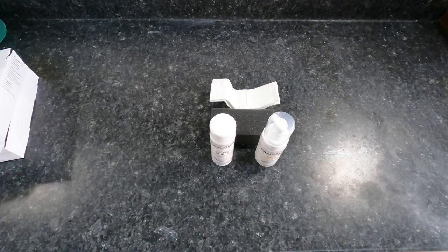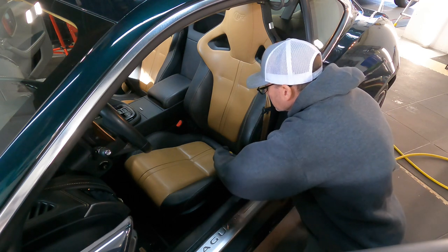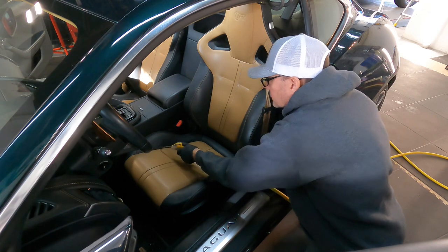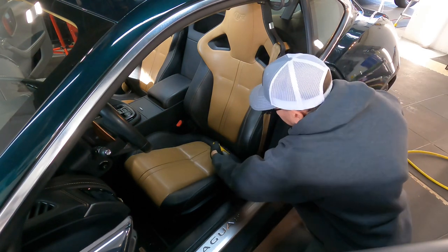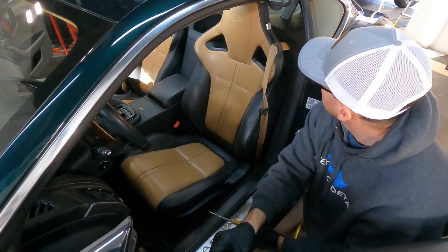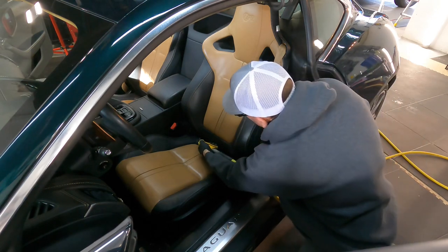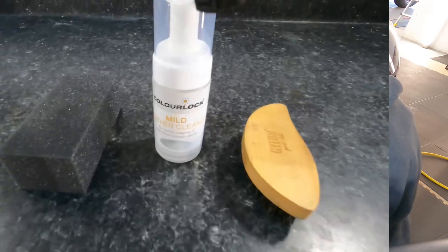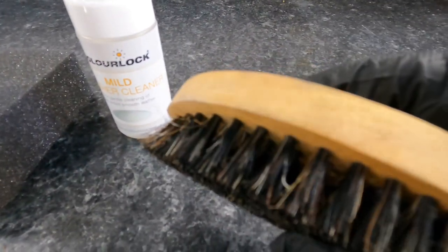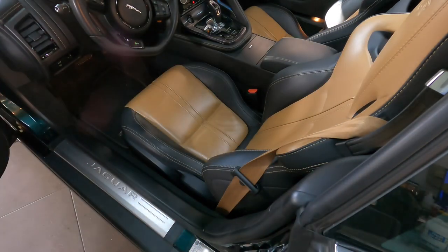Let's get ready to protect the vinyl and leather. I like to start off with compressed air and work any grit, dirt, or dust out away from the seams and in between the patches or panels. I normally try to stay away from any crevice tools or the end of a vac unless it is protected with a very soft rubber — that will keep you from scuffing the leather. I'll move the seat front and back to get as much of the exposed leather as I can.